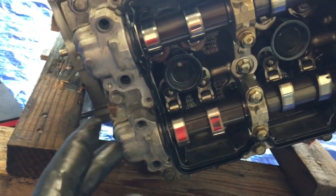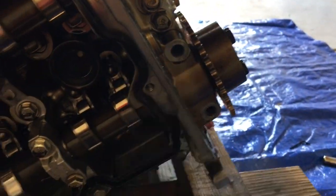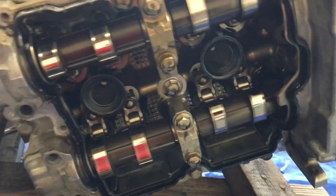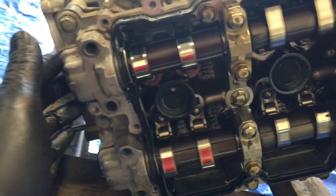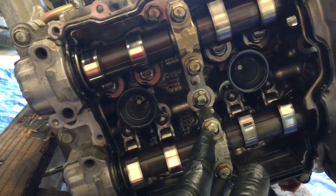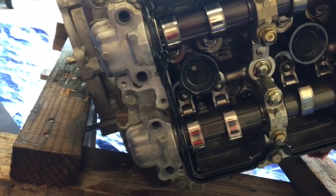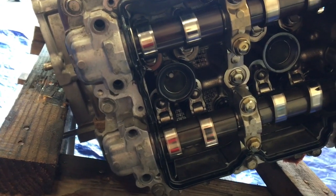It's all pretty self-explanatory on how these come out. There's the camshaft cover first, and then there are bolts here, here, right there, and right there. It looks like it's also RTV glued in, so a little pry bar might be useful as well. These should also come off, and once I get those cams off I'll let you know.